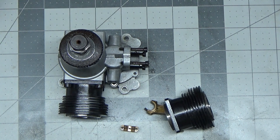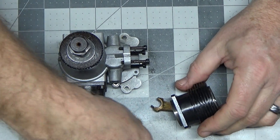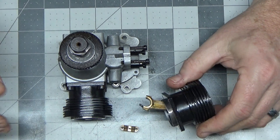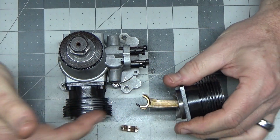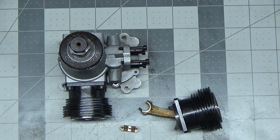I was the last person to assemble this engine — I put new bearings in and torqued everything as right as I know how. So this is maybe what we'd call inferior metallurgy or a material failure. The bottom line is it's a connecting rod failure of the fasteners — the screws holding the connecting rod end cap in place failed, with a screw head missing or a screw sheared. That's the post-mortem of this Magnum FT-160 disaster.